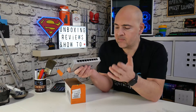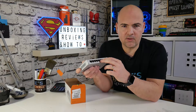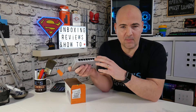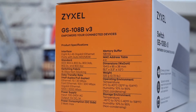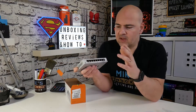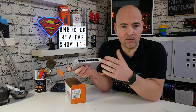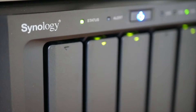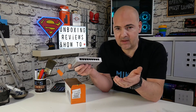If you're using this in a media center setup, you could do the opposite — have your PC and streaming device in the high priority ports and things like your TiVo box in the normal ports. The normal ports aren't reduced in speed in any way; they still get full gigabit speeds and actually support 2000 megabits per second — that's bidirectional 1000 megabits. If you've got a NAS box in the room, you'd want that on high priority because there will probably be a lot of people trying to access that data at the same time. If the network starts to get saturated, it will give priority to your file shares so video editing over the network still works smoothly.